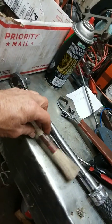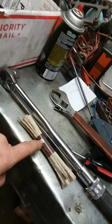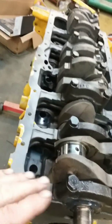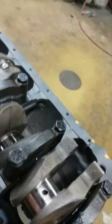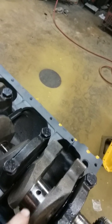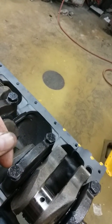You can go get these things at any pipe store, tobacco store, any place that sells pipe tobacco and cleaning accessories, or order them online. Get you some pipe cleaners, twist them together, and clean those galleys out real good — clean all the metal, anything that's in there. If you don't want to use pipe cleaners, you can use spray gun brushes, like you use to clean a spray gun. They've got those on eBay for around 10 bucks. Just take the time to clean that out, then take some brake cleaner, spray it out real good, take your air nozzle, blow it out real good. Any little piece of metal off that crankshaft that gets on a bearing will ruin it instantly — it'll tear the crank up.